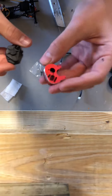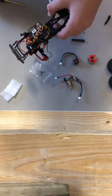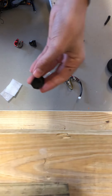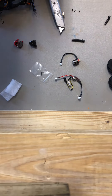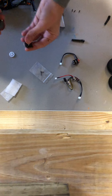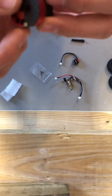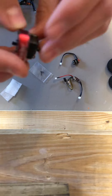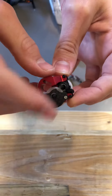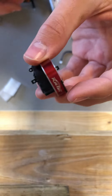We're gonna install the motor mount on this new transmission and then get it put into the car. I also took the wheels off just to handle a little less clutter. We took off this little cover plate, this little plate, and the spur gear, which we're gonna put back in in a second — and also this motor mount, this little carbon fiber plate. We're basically just gonna take this part and put it on there like that, nice in there, and just screw this in real quick. Now we got the motor mount mounted up, the spur gear in there, the plate back on, and it turns very well — very smooth. Looks really sick. It's gonna be awesome in the truck. Let's get the motor on it now. This is gonna be sick in the truck — it turns really well.